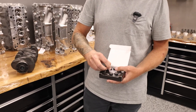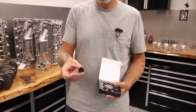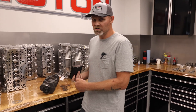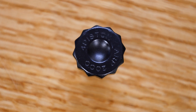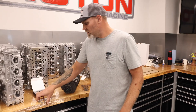So we have these bolts. ARP makes them for us. It's not a chromoly bolt like you'd see on a regular flywheel — it's an ARP 2000 material, so better clamping load. You also have guys at home just sticking old flywheel bolts that are torqued to yield on a couple of ooga-dogas and calling it a day. It's not how these work. You're going to want to torque these to 130 foot-pounds, and that's going to keep your flywheel on this high RPM, high vibrating engine.